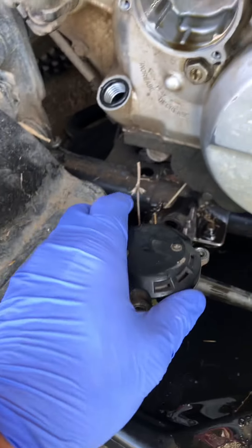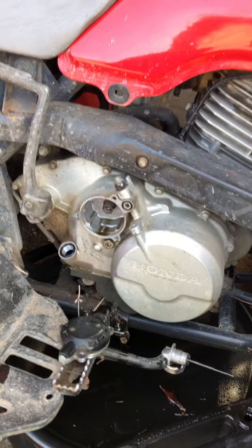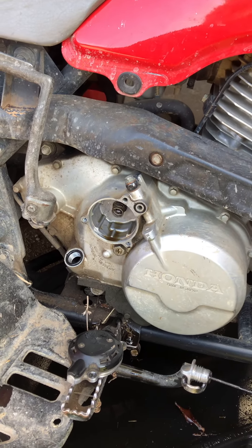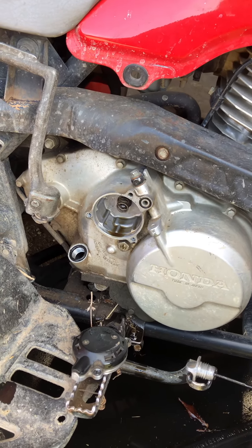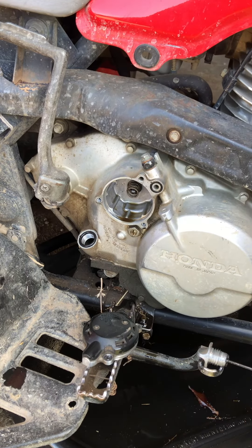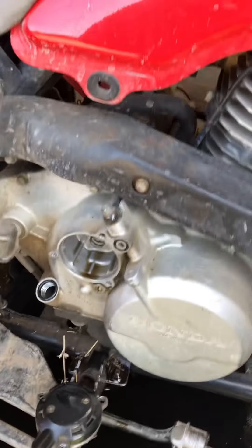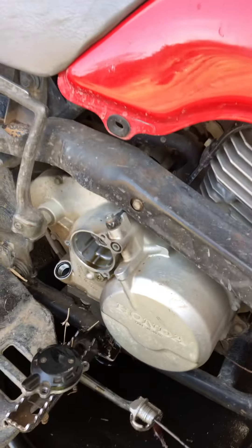It's pretty self-explanatory. Then you put your oil in here — it holds about two and a half to two and three quarters quarts of oil. I just put in two and a half, crank it over enough times that it fills the oil filter, and then I check it and keep adding a little bit until I've covered the full mark on the dipstick.